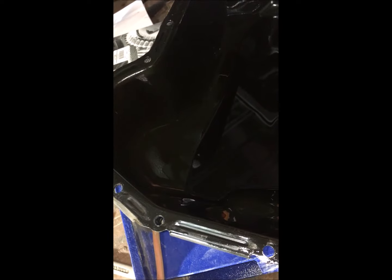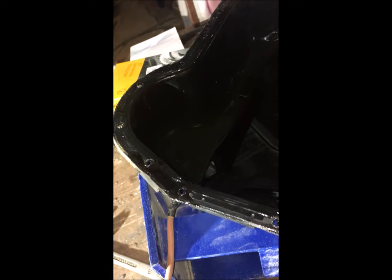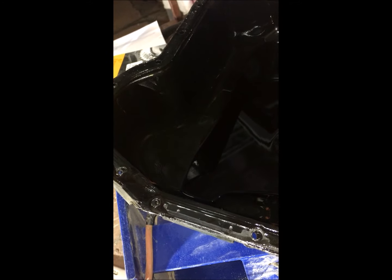Because I used engine flush, you can see my oil is really really thin. If you do use engine flush, never drive your engine too far — never drive more than 10 minutes with your oil being so thin because you can hit a bearing knock if you do that. So be careful: throw the engine flush in, rev your engine up around the block so it works through the engine, then park the car and loosen your drain bolt to let your oil run out.